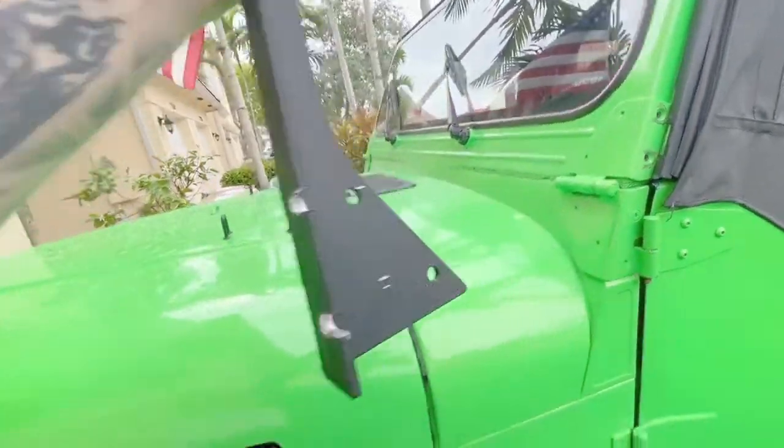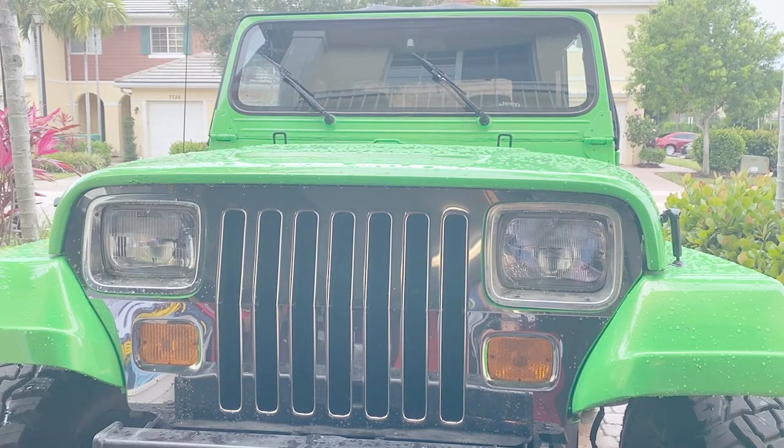and then I'm going to start mounting. I'm going to start loosening these torx screws on the window frame, and the correct size is a T40. Now mine, because they have so much paint in there, initially looked like a T30, but it is a T40.